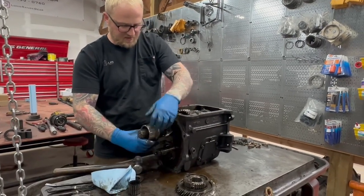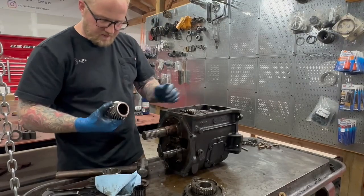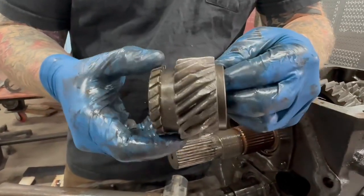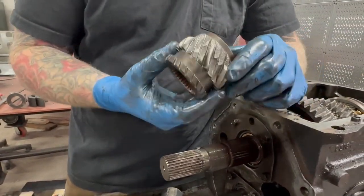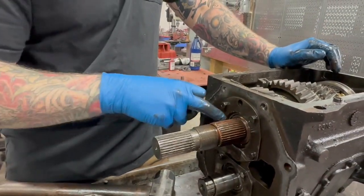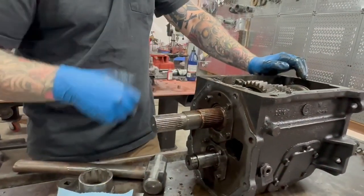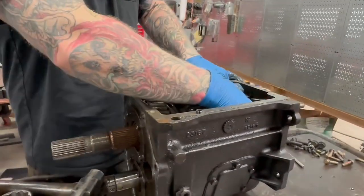So far I'm optimistic that's been the only damage. This is a full spline main shaft — it's an older installation, you can tell by all the rust inside. I replace every single fifth gear on every build I do as well as the main shaft, so there's nice tight fitment and no wobbling. Obviously there's a lot of clearance here. Anywhere you see rust or that varnish glued to the surface, that means there's not metal-to-metal contact. That's part of the reason why we insist on putting a new shaft, a new gear, and a new nut on every single one.